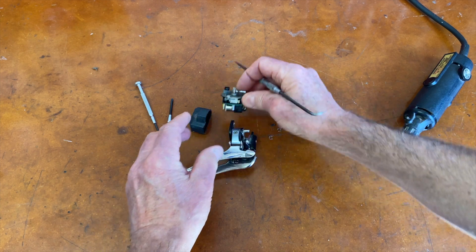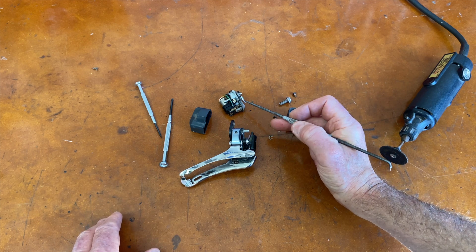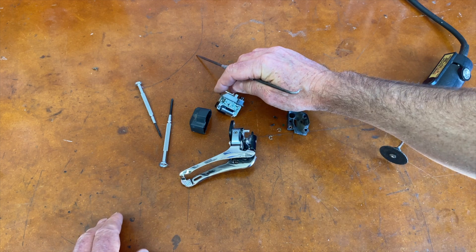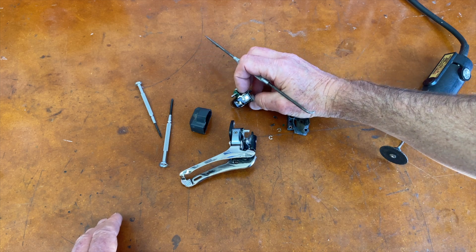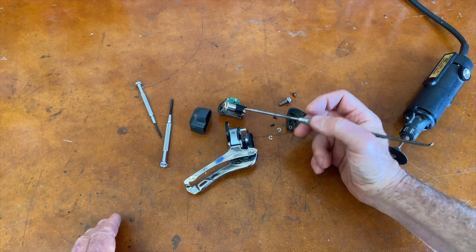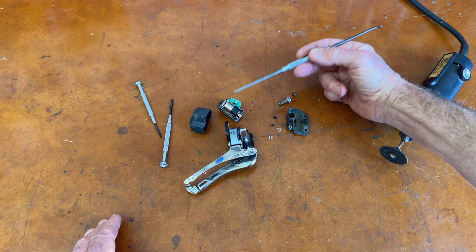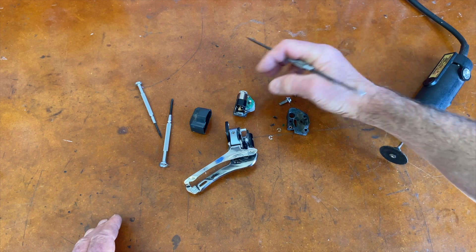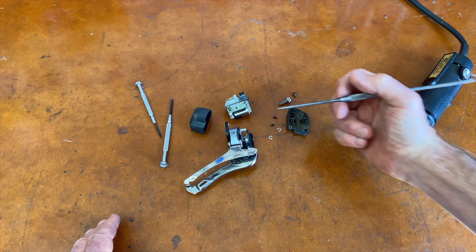On this side, you can see the plug, and that's the little arm that completes the parallelogram that shifts the derailleur in and out. As far as I can tell, this arm right here is the only thing these gears are moving. If you look at the gears, there's your circuit board. There's one gear that looks a little bit like a worm gear right here, but it's not a nylon worm gear — it's brass. So what I'm going to do is take the motor out of there, take the circuit board off, and maybe underneath here we'll see some more interesting things.